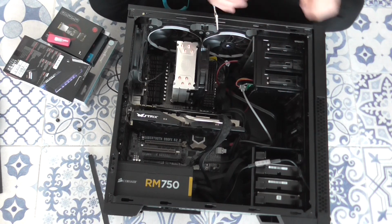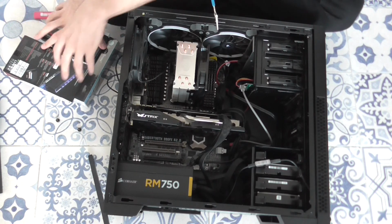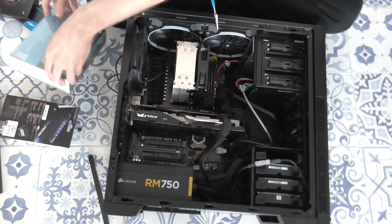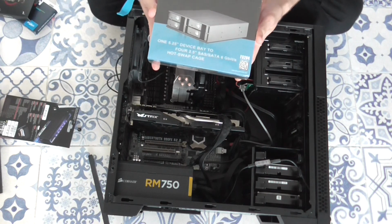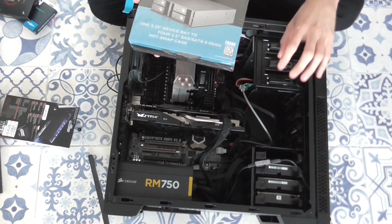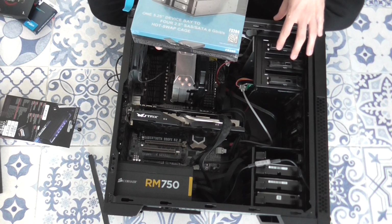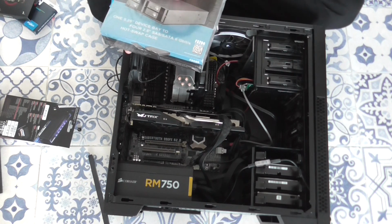So I thought, let's get rid of this jerry-rigged, just hanging there drive, and let's put some faster storage in and some expandability. Because I'm really starting to run out of space now, so I would like some more space. So on the normal SSD side, I've got myself this, which is a Silverstone Caddy, and I can put this in the 5¼ inch bay, in between the floppy drive, once again, don't ask, there's videos on it, and my optical Blu-ray writer and reader, and that gives me a little bit of expandability.